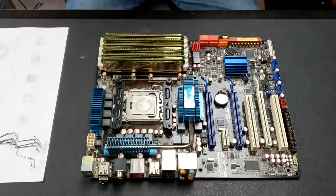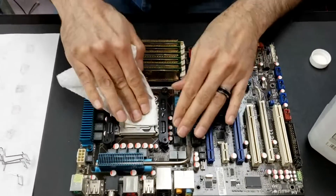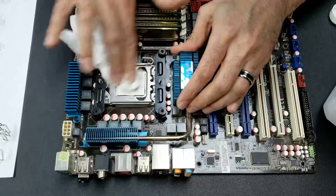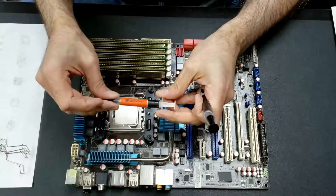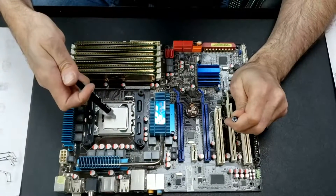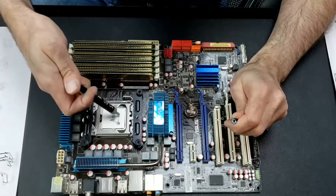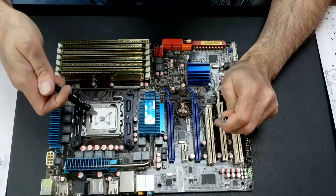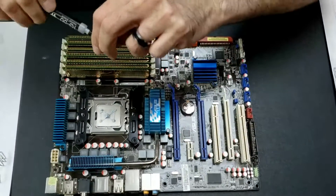We're going to start mounting the fan pretty soon. There's some paste left over from before, so I'm just going to take a paper towel and a little bit of alcohol and wipe that off, clean it up. We're going to put this new paste on there, and I like to have it cleaned before we put the new paste down. It's nice that they give you this Cougar paste with it, but I like this TG-50, so I'm going to go ahead and apply some of that. I do one bigger glob in the center and then four smaller ones out in the little corners. Don't put a ton of it on there.